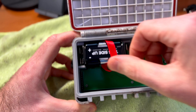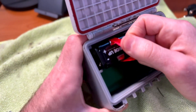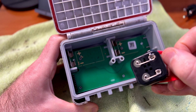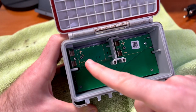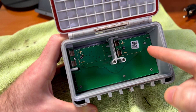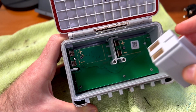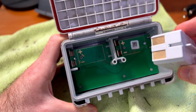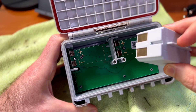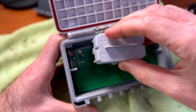We need to use this ribbon to pop the existing battery out. Now that's out, I'm just going to make note of where the contacts are. This reminds me that I've read in the past that you can actually install a second one of these batteries for another $19 and double your battery life — or one acts as a backup for the other. But I didn't think ahead, so back to just the original battery configuration. There's a plus and minus sign for positive and negative — just match those up on your batteries like so.